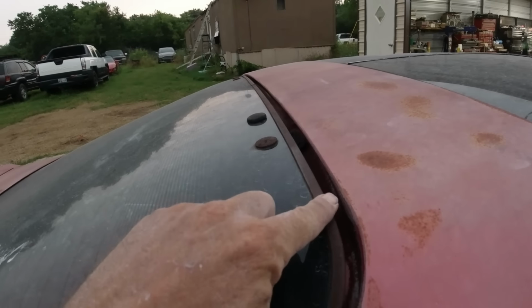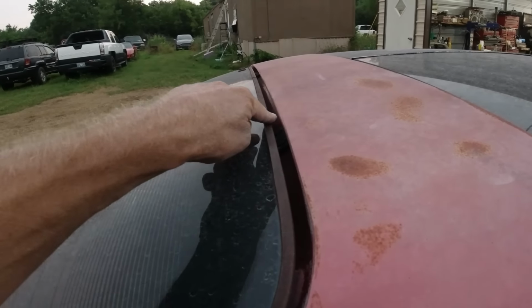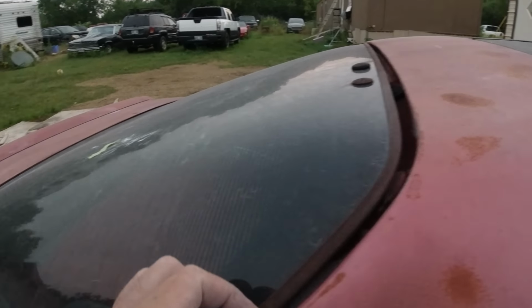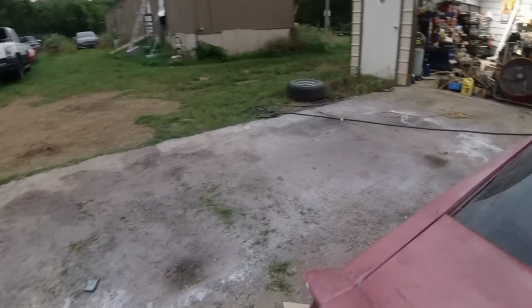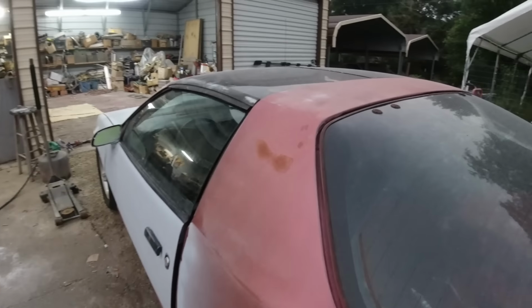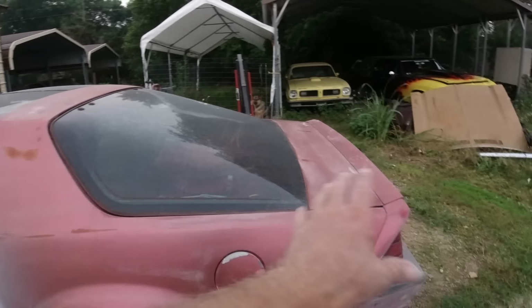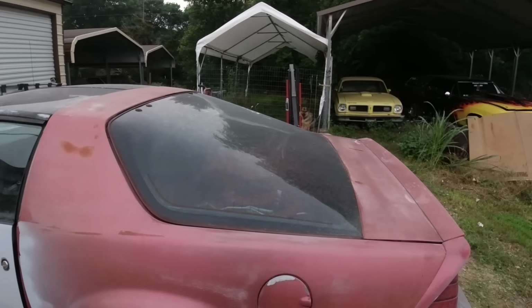Take a lot of little hand sanding in all the edges. And this is gonna be painted black, but they all do this on these Camaros, this back there rusts. So, you know, I'll be a couple hours just doing all that little stuff. But yeah, we'll take the DA sander, sand all this while it's outside.